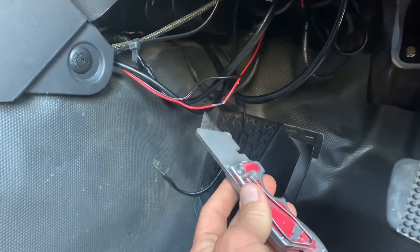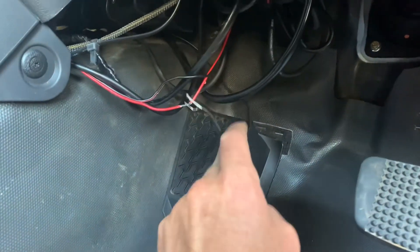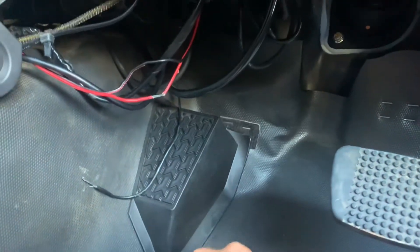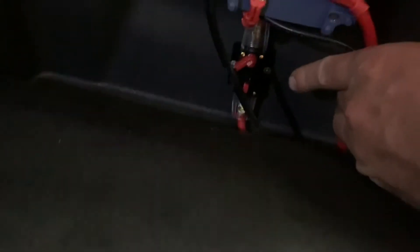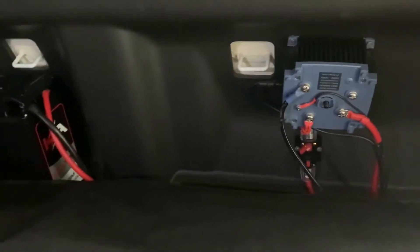The clamp is on the UHF up there, the test light is into that wire, just clicking the ignition — turn on the ignition and there we go, I have ignition power across that wire. Peel it away a bit at a time all the way around, attach this wire onto here, solder it, tape it back up, and tuck all these wires back up there with a few cable ties. One last thing to complete the system is putting in these inline fuses.